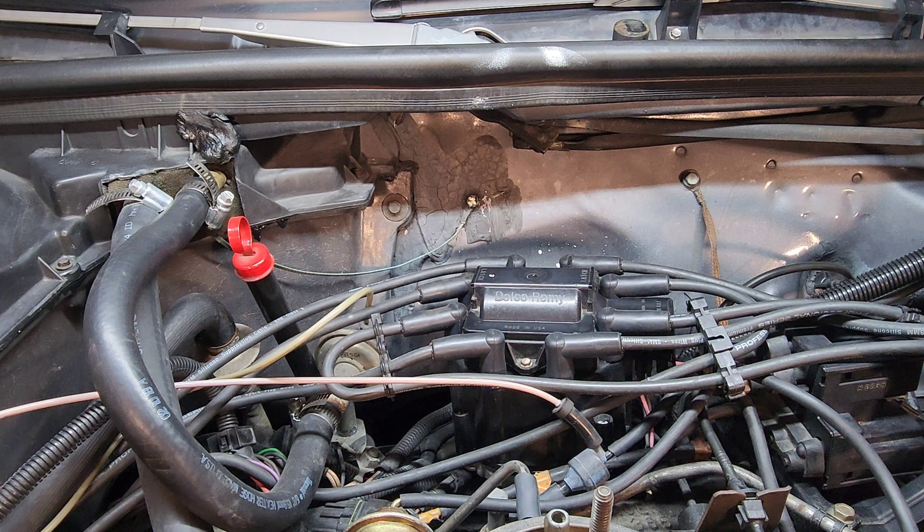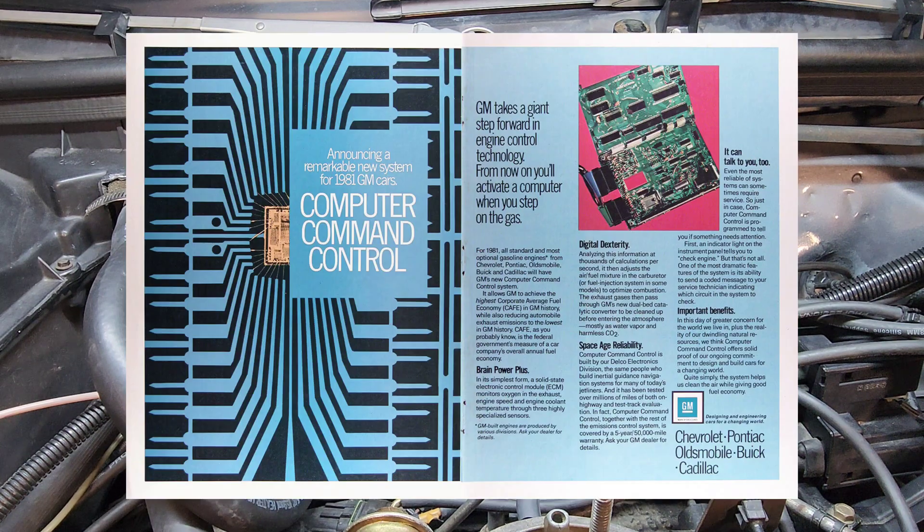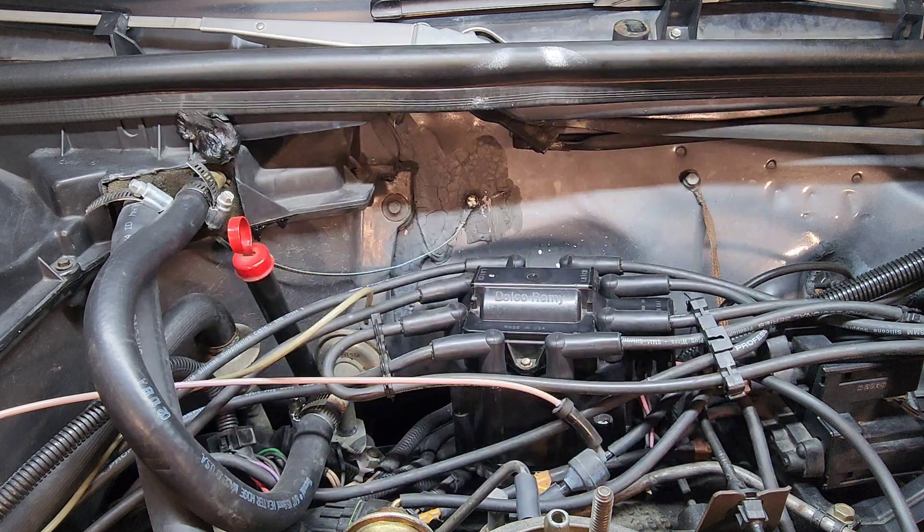The later iterations are the seven-pin system. That eliminated the vacuum advance and weights, but kept the knock sensor — this time connected to the engine computer in the GM Computer Command Control system, and all timing retardation and advance was handled by the engine computer. Every distributor setup has a connector located usually in the bottom left-hand side with the number of pins. So if you have four connectors you have a four-pin system, five connectors a five-pin system, seven-pin and so forth. These pin connectors will eventually connect to the module underneath, which I'll show you in a few seconds.